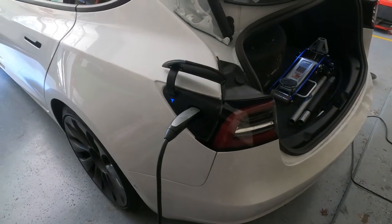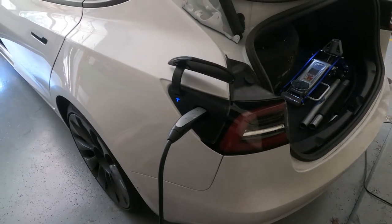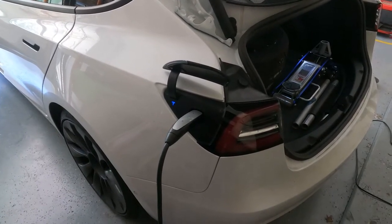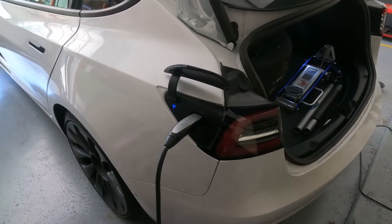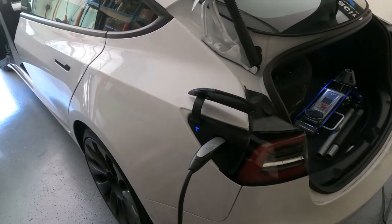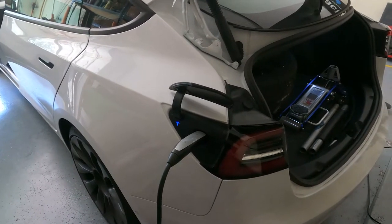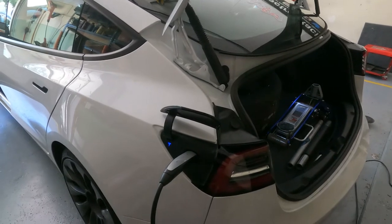One of the other obvious questions people are gonna ask you is how much juice do you need to go autocrossing? Well, the peak power I've seen on some of the forums and on the internet is at 90% state of charge and at a certain temperature. So I usually try and arrive at or above 90%. And keep in mind, above 90% regenerative braking may or may not work. I think the cutoff point is around 90%.